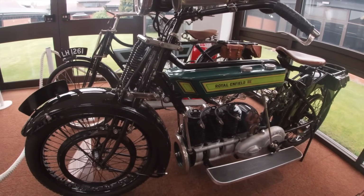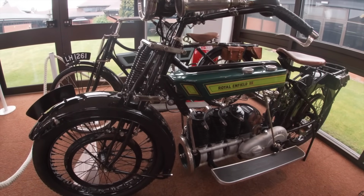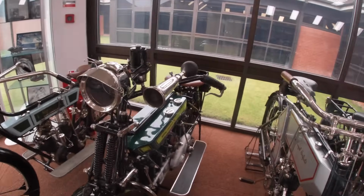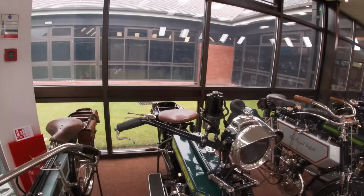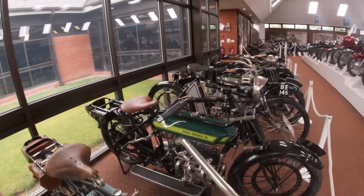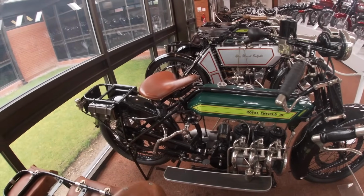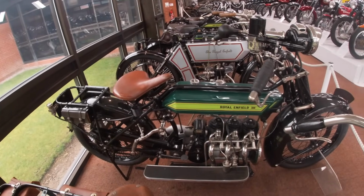Interestingly, in a forerunner to disc brakes, the bike uses a dummy rim on the side, rather similar to those that have been used for belt drive, into which runs a stirrup which applies the brake. I've seen a similar system on some competition Douglases of the period. Unfortunately, the bike would never reach production, so I'll never really know just how well it would have gone.